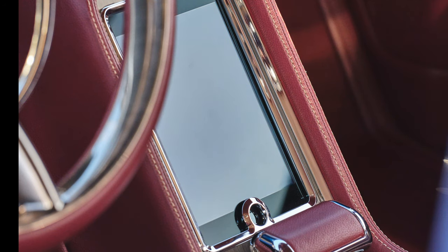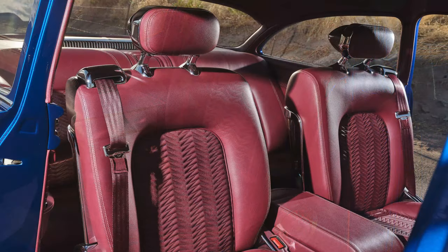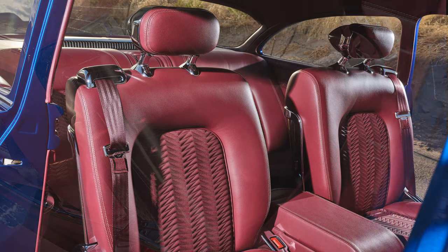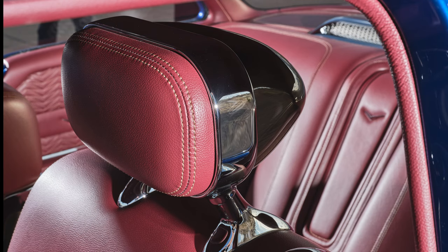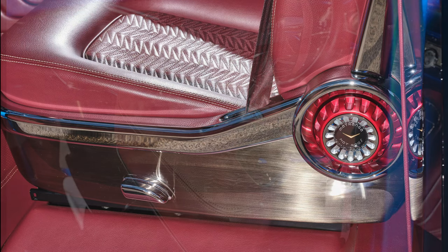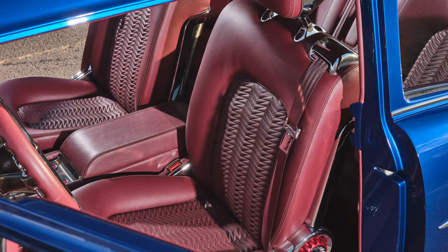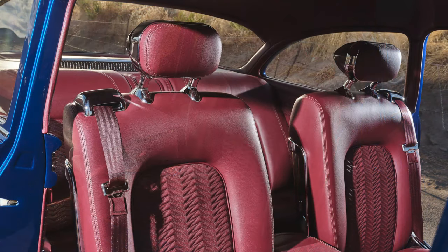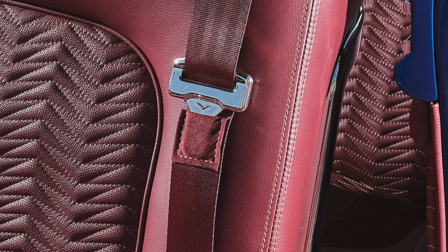The front seats have 80 brand new parts each — that's how many it took to build them. Ryan Rivers built beautiful handmade shells for the headrest, seat back, and seat bottom. Evo Industries machined all the parts I designed in SolidWorks, then we plated them all to create a really dramatic shape out of what was a Chrysler recliner convertible seat, chosen because it had an integrated seat belt. We didn't want seat belts on the post, so we made the seat look really cool — there's a little chrome cover the seat belt comes out of, and the seat belt itself has a stainless buckle machined with a little V logo. We stitched a little pocket on the seat belt so you can show off that piece when you're not in the car.